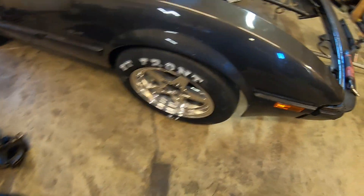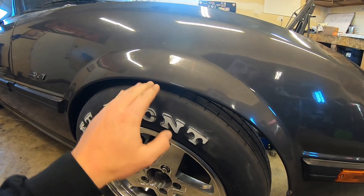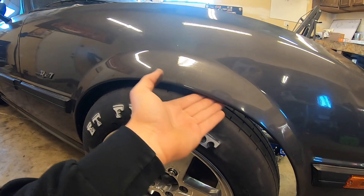So I want to try and chop this bracket off right now and slide the bracket up to see if that fixes our camber issue and see if we have any issues hitting on the fenders. They are very close, but I think once it tucks this camber in more it won't hit, or I'll just have to get these rolled - which won't be a big deal. Those are the plans for today. I'll go ahead and start cutting this shock mount off of the shock body. Hopefully I don't cut too far into it - it looks like there's a lot of pipe there, so it shouldn't be too big of a deal.